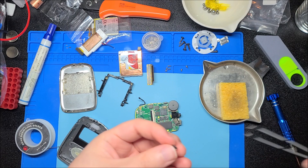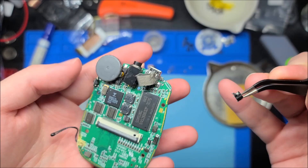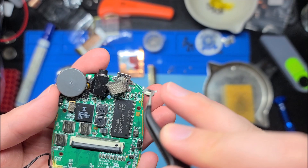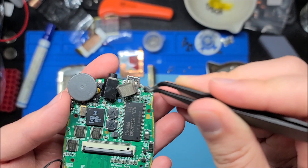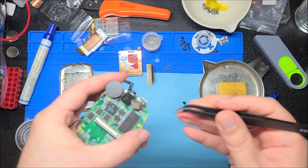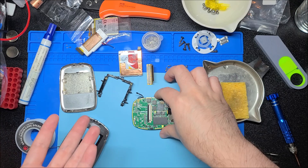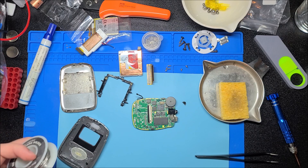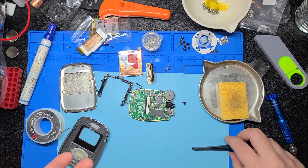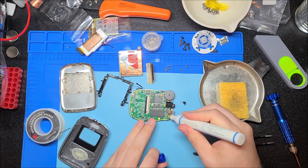In terms of where it's going — it goes right on here. You can see the four pads: these two are the ground shielding pads, and the two behind them are the actual signal pads that, when you press the switch, shorts those two together to send a signal to the main chip. I'm going to be soldering this — I'll probably add some flux and clean off the old solder, which is likely lead-free. Lead-free solder has a higher melting point and is a little more brittle, while leaded solder is more malleable and has better mechanical properties for standing up to stress.